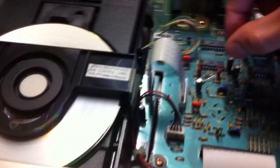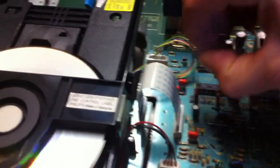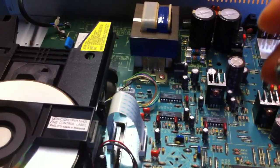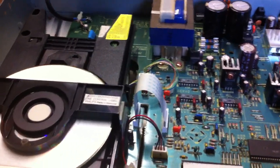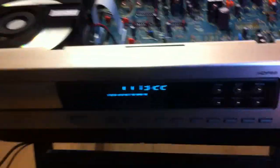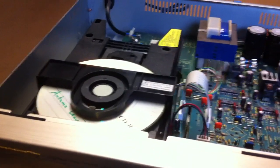So it's not the laser going bad, but the focus error. I can remove the resistor now because it's locked in the servo loop. So with the resistor removed, I press play again — and again — it doesn't start up.